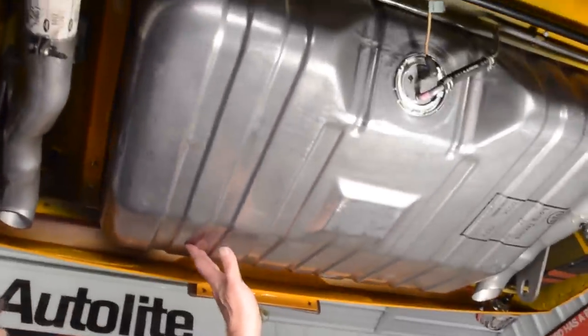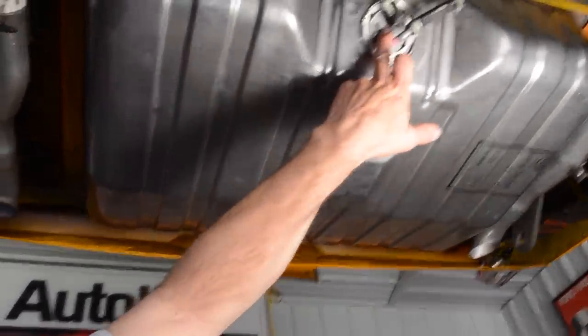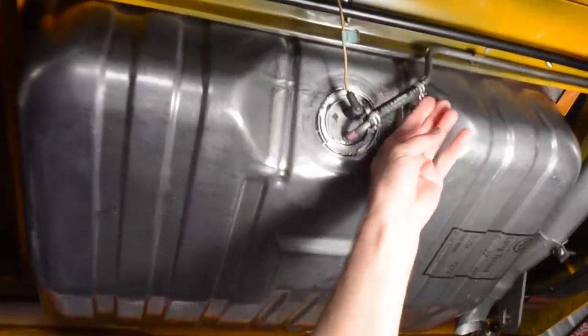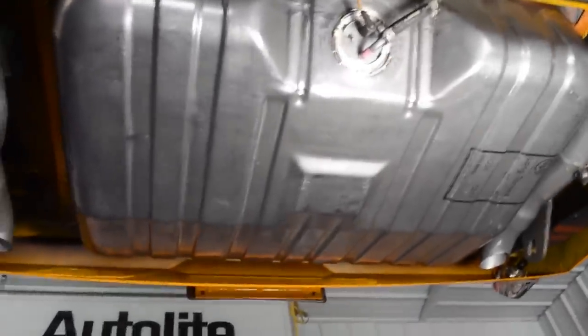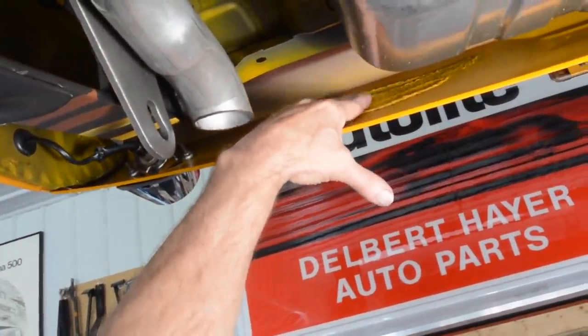Gas tanks are actually tin-plated steel — a lead-tin coating. The sending unit is also tin-plated. The hose clamps are the knuckle scratchers with square tabs on them; the new ones sold today have rounded edges so they won't cut your fingers as easily. The rear valance was painted on the car with just a couple of screws hanging, so you'll see some body overspray in there along with factory sound deadener that was put on before the valance was installed. Up inside, you'll see bare metal and primer in areas where overspray from painting the unibody didn't reach.